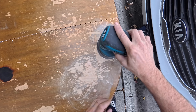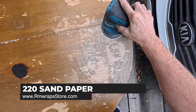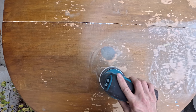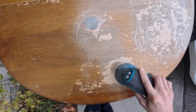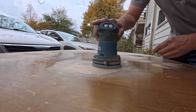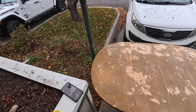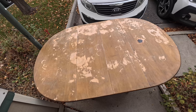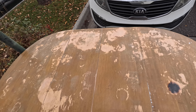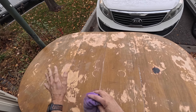I first tested out the 80 grit sandpaper and it was a little too gritty, so I normally use 220 sandpaper. What I'm doing is getting all the little high spots off and just getting a little bit of clear coat off, getting it nice and smooth for the wrap to go over. If you feel with your fingers and there are any divots or bumps, I felt a few bumps there, so I did a little more sanding right there because I missed that spot.